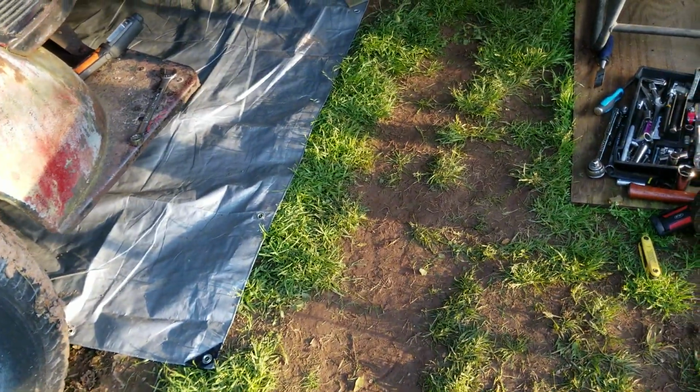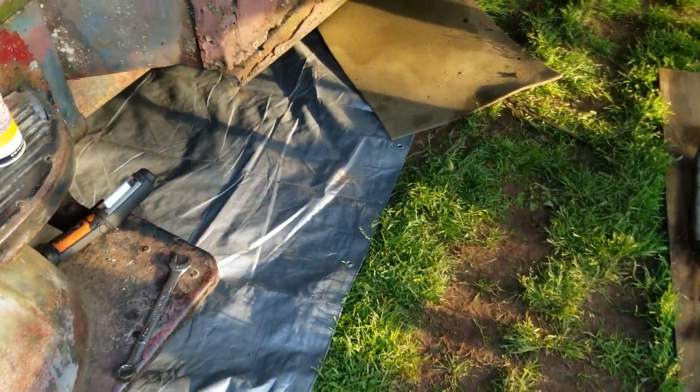That is the old brake lines. I put all new shoes, had to get them relined. Then I had the, it's an old Hydrovac power unit I had to have sent off to be rebuilt. That's what you're looking at right here. Jimmy's classic truck parts helped me with that one.